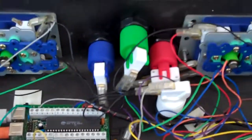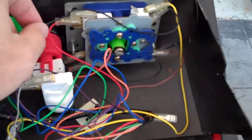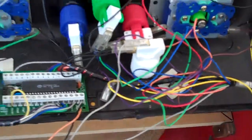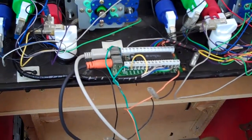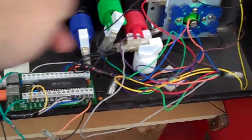It's already pre-configured for main setup. The joystick and button wiring — just a tip for you with your joysticks: make sure you wire them all up so the ground is common. That way, if you have a wire that breaks, it won't show an error in a hurry because you're running one great big long loop.